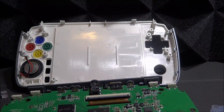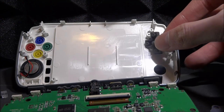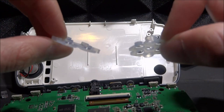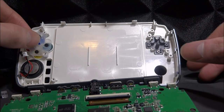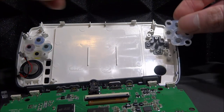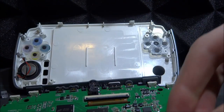I took everything out so I can show you how to put it back — maybe something fell out and you're not sure where it goes. First thing to put back is the D-pad, which just goes in here at the side in its cutout. Next we need to put back these rubber pads. They're exactly the same so don't worry if you've got them mixed up. The notches face the buttons and the D-pad, and you just hook them over these plastic pegs. One rubber pad is for the buttons, the other side is for the D-pad.